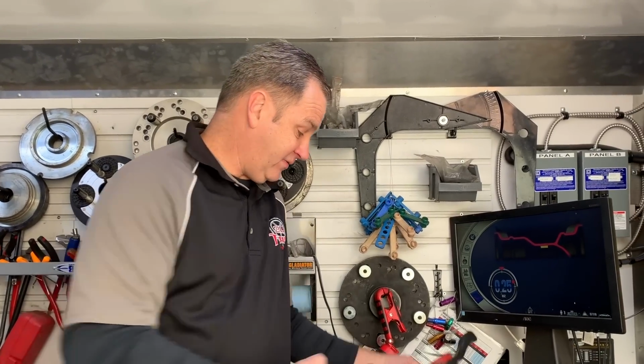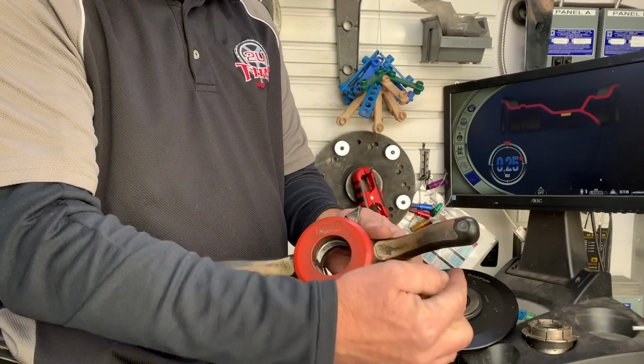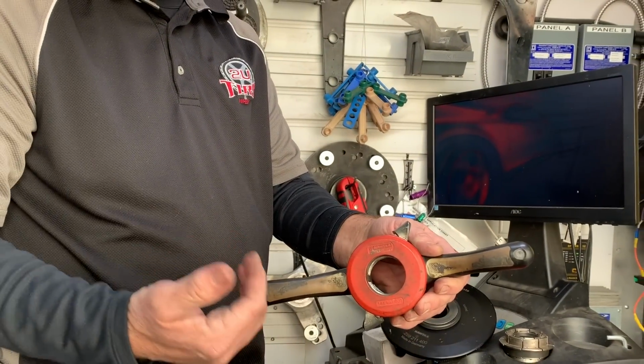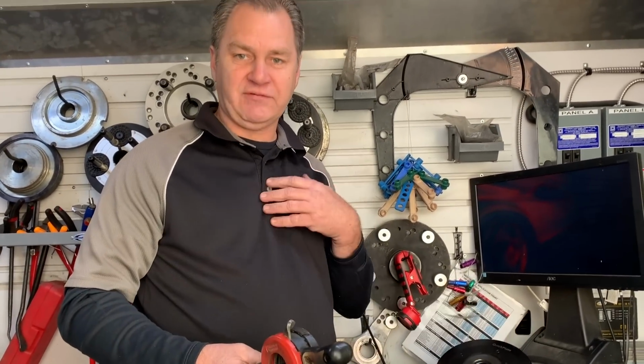And a lot of times, even in the shops, this is the wing nut that essentially holds all this together. I'll find many times that the wing nut's got a chunk missing, something that's wrong on one side that's causing the wing nut to not be balanced. And then they're chasing weights, and you go back and go back. I never even thought of that. Yeah, I've got clients that have gone back 5 or 6 times, and they still have vibrations, and they finally find me, and I fix their problem usually within about 45 minutes. Essentially, a road force balance with this type of precision, and I've got a customer for life.